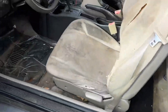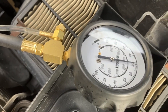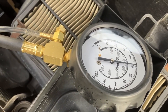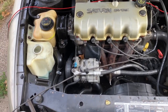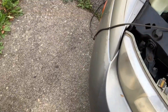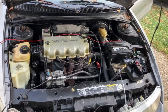Looks like she's fixed. She's holding fuel pressure now - before she would just bleed right off, not even holding the 8 or 9 pounds she was getting. That should take care of the lean code as well. This thing's ready to get out of here. You just got to know how to troubleshoot things, have some tools to do it, and cars are not hard to fix.